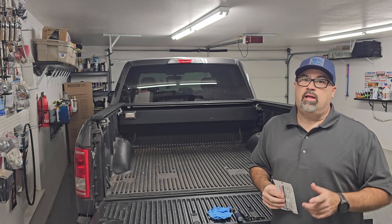We're going to go back to the middle here to get our third brake light — that light was definitely out. I can see black spots on the bulb, so that was definitely out on us. Let's get our red bulb in and that third brake light replaced, and our last clear bulb for the cargo light. Light it up, push that bulb right in, feed it through, line up those tabs, turn it back about 40 degrees, and the wiring is all loomed up in there — just let it sit right up inside.